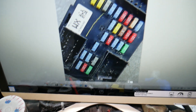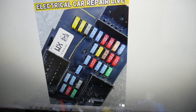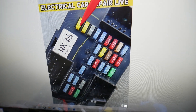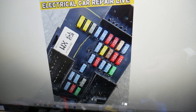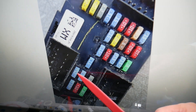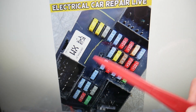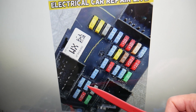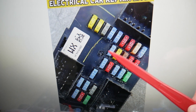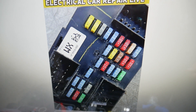For the brake lights, there will be multiple fuses to check here. Things get a little bit interesting in how they position these fuses — they're laid out a bit differently. They go one, two, three, then fuse number four, five. Fuse number five is the first one we need to check, right here. Then we go to six, seven, eight — fuse number eight will need to be checked as well. Then nine, ten, eleven, twelve — fuse number twelve. So in this fuse box you have fuse numbers five, eight, and twelve to check.